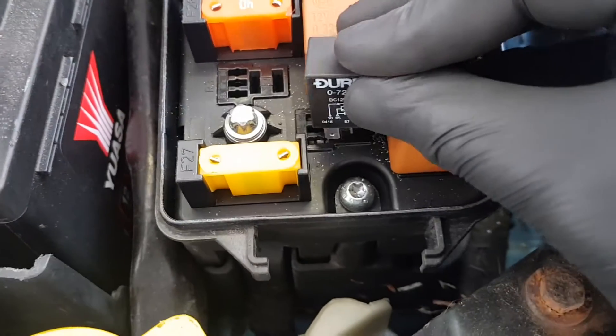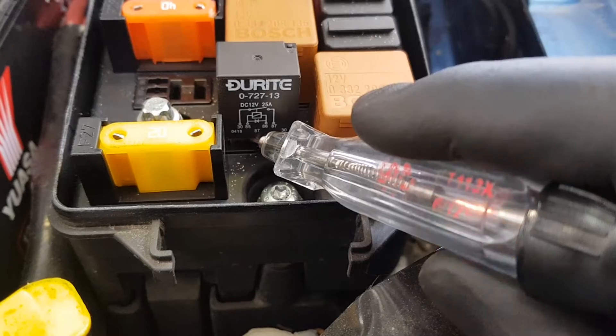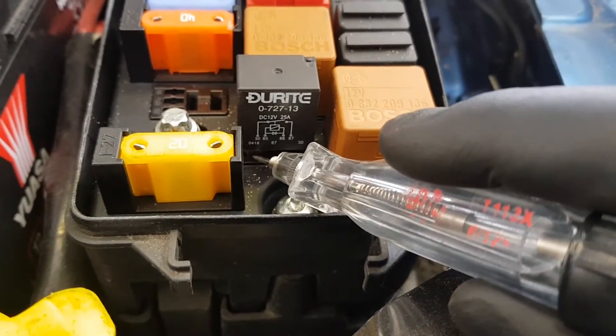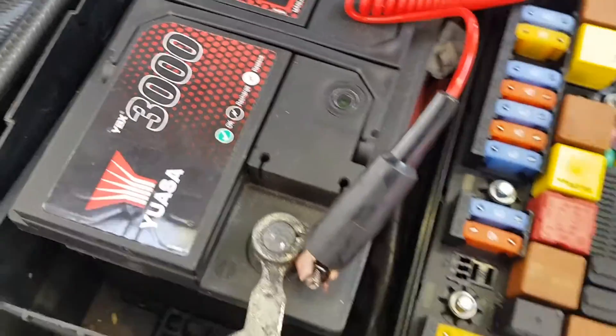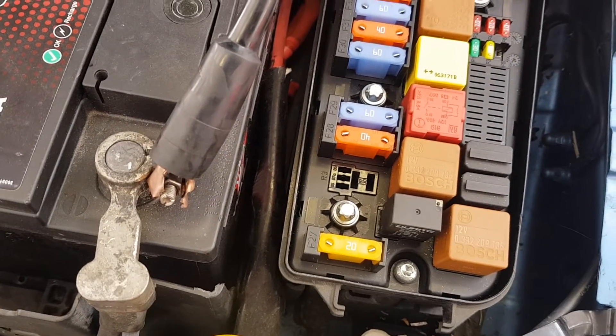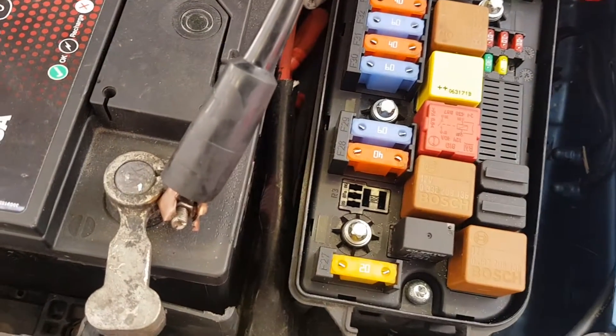I've put a ground to this back pin here, where it should be grounding out. If you can hear that changing note - you can hear the relay click, you can hear the compressor cutting in and out. So we've lost control on this relay. We're going to go find out where that's gone, and it goes directly to the engine ECU according to the wiring diagram.